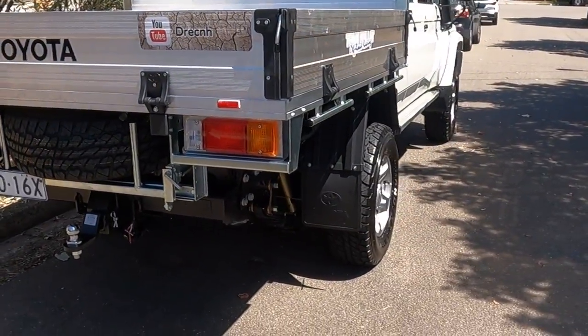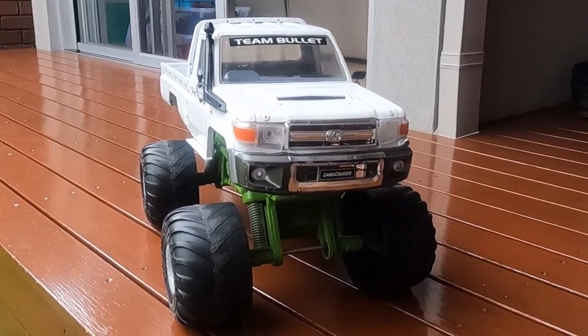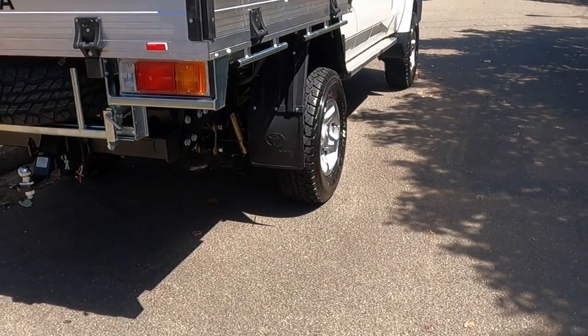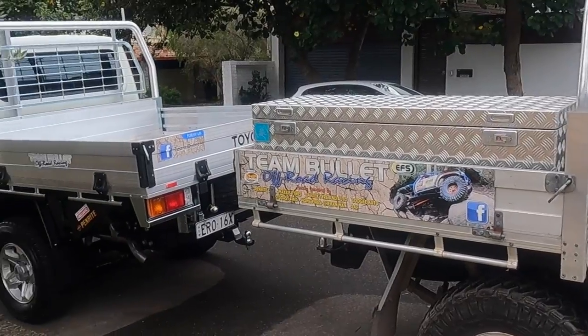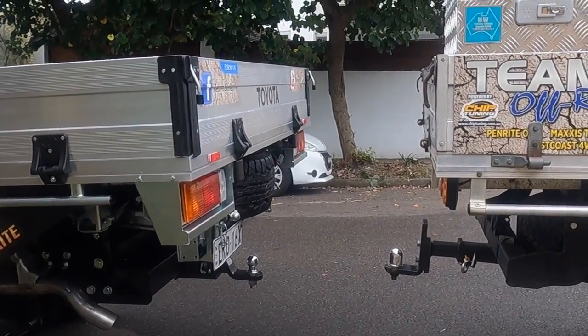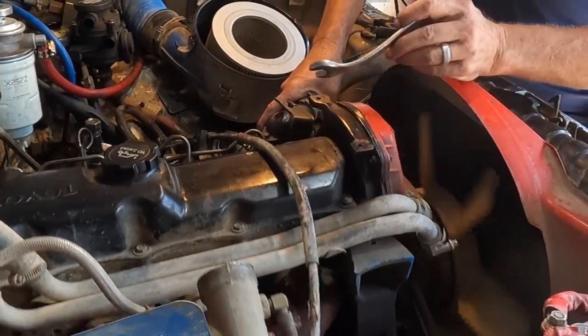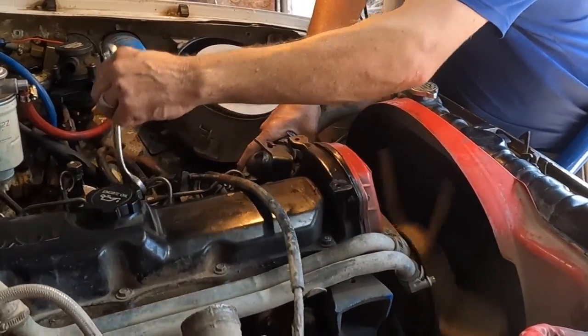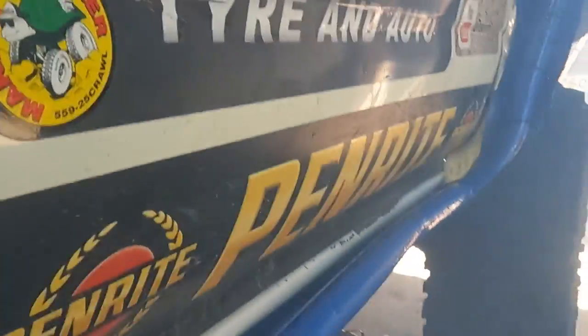We're four inches wider now — we marry up with the front. In my opinion it's where it should be after paying Toyota for the vehicle — not much to ask for. Even the toy ones come the same width. At least now when I'm driving through the sand the back wheel is going to follow the front wheel instead of being two inches inside it. I'll get the toolbox off the 106 and put it on the 79 — interestingly the trays are exactly the same height. Next episode: one word for it — bad. We put Bullet Truck back together, spent all day on new injectors and new glow plugs, and it did not run. You'll see all that in the upcoming episode. As always, thanks for watching.